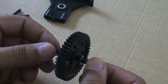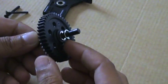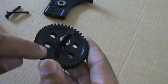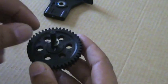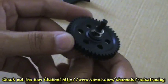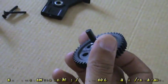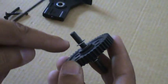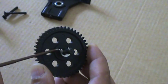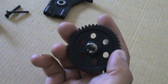Now all you need to do is make sure you know how to take this gear out and replace it with a new one. So this gear can come out from one side easily because the other side is locked by that small metallic pin in there. So you can see there are some E-clips on it, also called "Jesus, where did it go" clips, because when you're taking them out and if you're not careful, they are just gone, and you will be finding and saying where did it go. So just move to the side where you have 2 E-clips, because at the back you can see there is a metallic pin to lock the gear on the shaft. So at this side, on the opposite side, I will take these E-clips out.